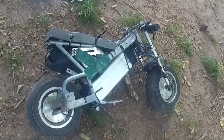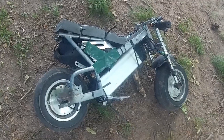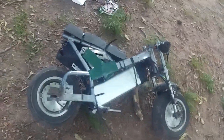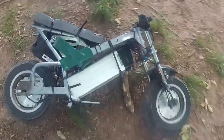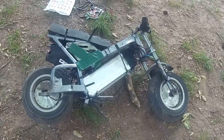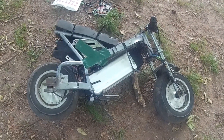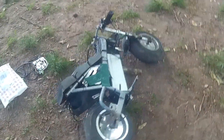It has regenerative braking. On the pull-up video, when I pulled up and stopped in front of the camera, I was braking on the regenerative braking that puts the power back into the battery. Going round the bike, there are no brakes. It does about 22 miles per hour flat out. You can easily slow down to about 3 or 4 miles per hour just on the regenerative braking and then put your feet down — it really doesn't need brakes at all in the mechanical sense.